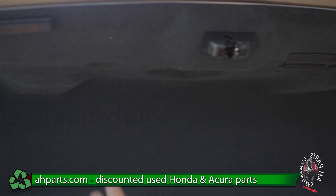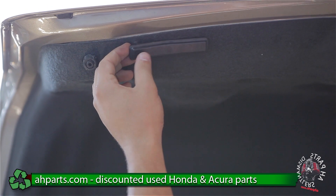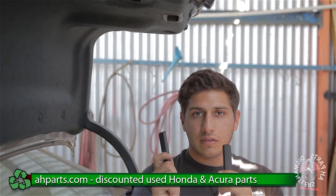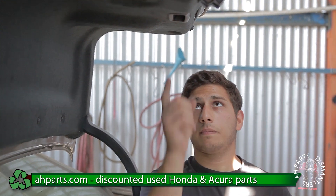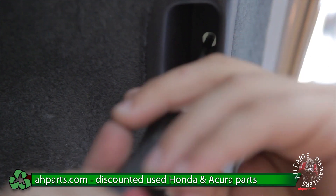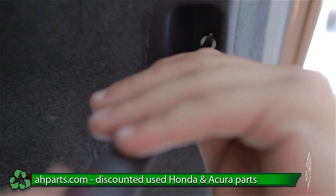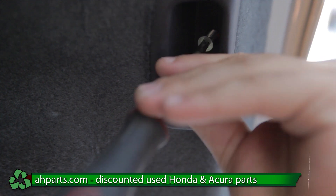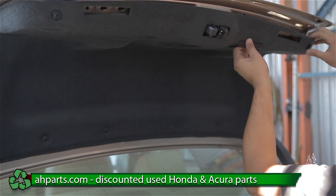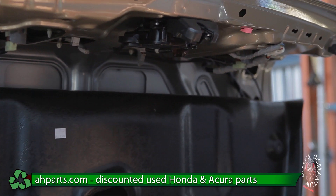It's the same thing for the other side. For the driver side we're going to work on the driver end of the rubber piece — the left side — and then we're just going to push this the same way, and that comes out like that too. After you take out these rubber pieces we're going to want to take out this plastic piece up here. We're going to take our Phillips screwdriver and there's a screw that we're going to need to take out. Now after you get that screw out I'm going to pull everything over the latch and we can just swing this down, which will reveal the latch.